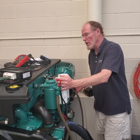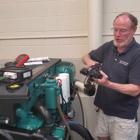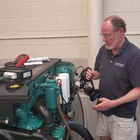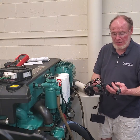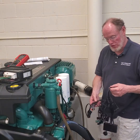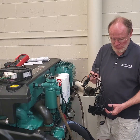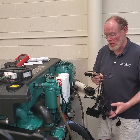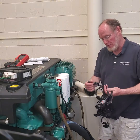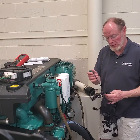I wanted to go over using the new engine breakout box. This is a five-pin breakout box, part number 885-675, and it has all the adapters to the engine. The first thing I wanted to go over — because we just did the high pressure pump removal and installation — is to check the m-prop. The m-prop, or magnetic proportioning valve, is the device that controls fuel delivery to the engine.